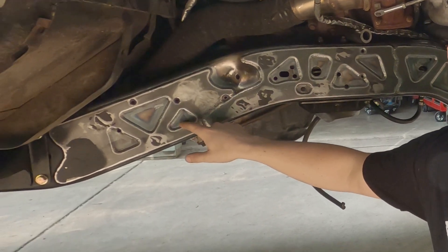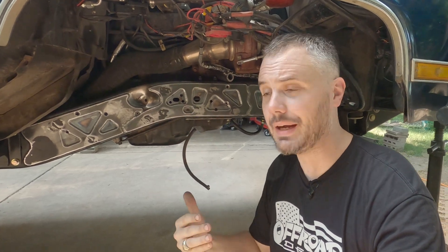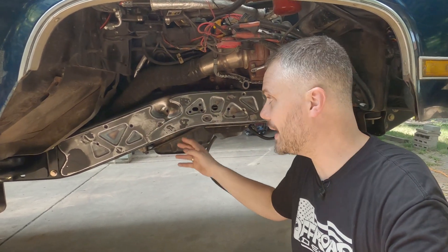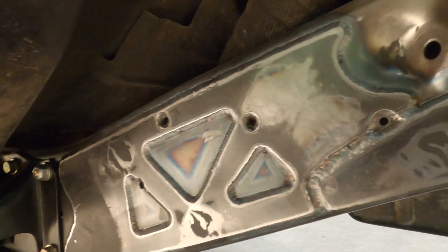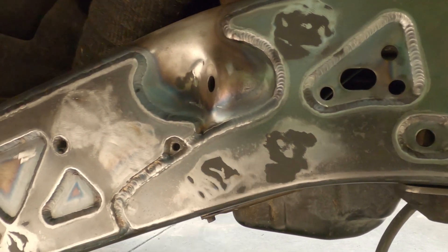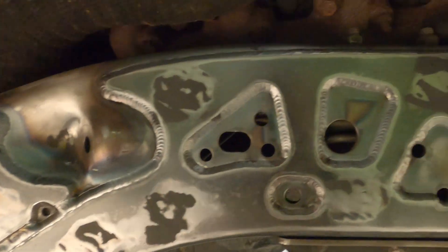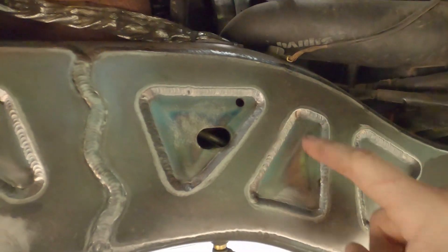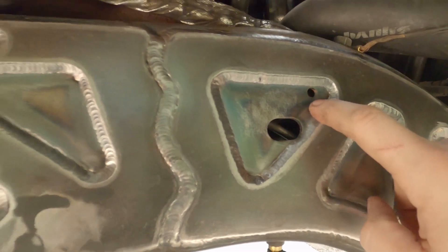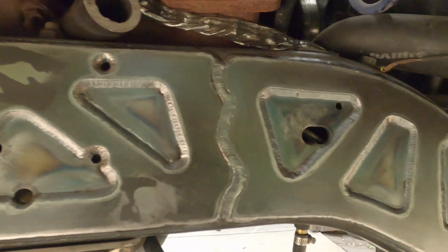I like these window plates because they're kind of like trussing — like a bridge. And they're built in three sections, so if your frame has a little bit of a tweak or is a little fatigued, you don't have to scab a whole piece in from front to back — you can just put in these three and clamp them together. I've got all three burned in. You can see this is just filler primer — I will blast filler primer over the plug welds to make sure it's nice and smooth before painting. It takes very little extra effort but has a big effect. These add good strength and you still get access to holes for your fuel lines, which are all over here, and they look cool.